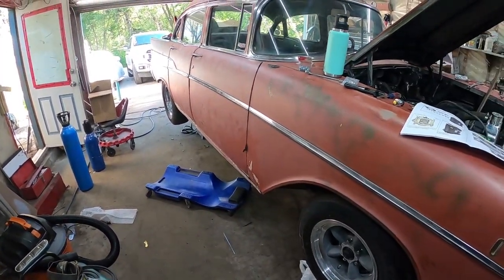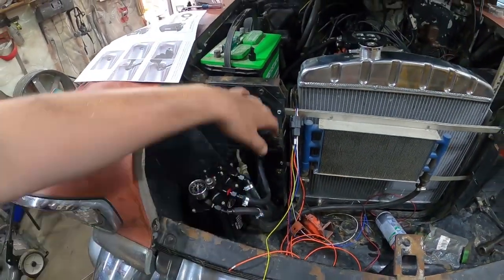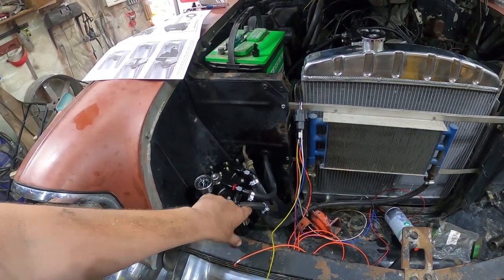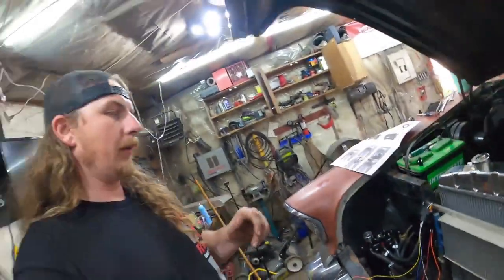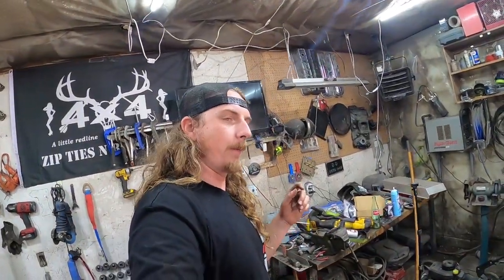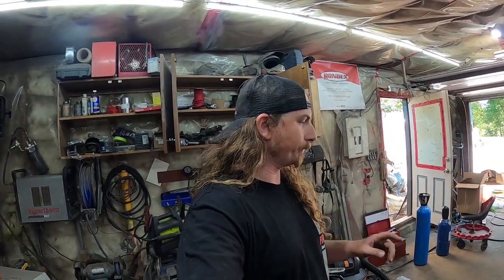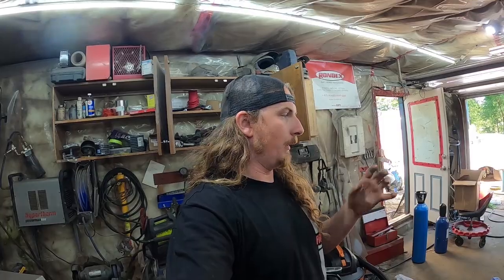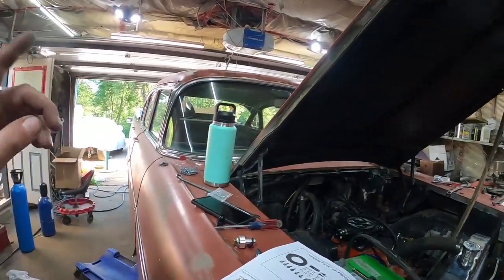Okay, car's up on stands. So I'll show you what I've done up top. I've got the return line just really roughly run. Now again, this is just regular carburetor fuel hose because this is kind of temporary, the return and the feed, because I'm talking with Hot Rod Fuel Hose and they're going to send over some sweet line and a proper electric pump, so my junk won't be on here forever, but this will get it running and just kind of get the vibe of it. I've got the O2 sensor in. I decided not to weld it and follow what the instructions do, where it's clamped on. If you guys ever want to move it or do whatever, it's literally two clamps. Super easy. The last thing I'm going to do, I'm going to put the return in the tank.